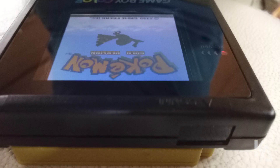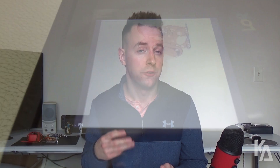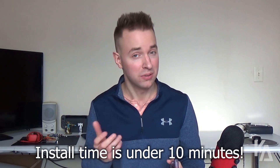There's no more ribbon, no more ordering a separate screen from eBay and hoping that it's compatible. The new screen has superior viewing angles — you can view it in direct sunlight, and it has a generally crisper and more vibrant picture on screen. There's no soldering required to install it, no more 3D printed screw mounts. This thing is the dream mod for the Game Boy Color, and it takes less than 10 minutes to install — if you're really trying, you can probably do it in five.